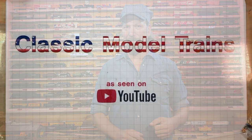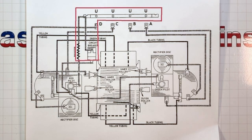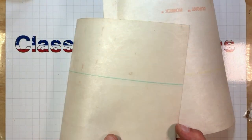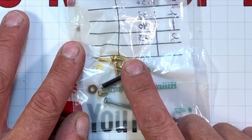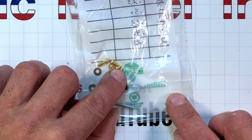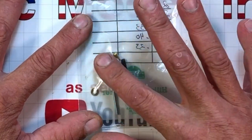There are a few items you're going to have to have: an illustrated parts breakdown of the independent control knobs, an electrical wiring diagram of the specific ZW you're rebuilding — remember there are three versions. Get some fish paper, which is a non-conductive paper. Get some high-temperature 14-gauge wire, and some miscellaneous small screws — 6-32 by one inch, or you might need 4-40 by one-quarter-inch screws, half-inch long or less, plus washers.